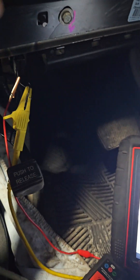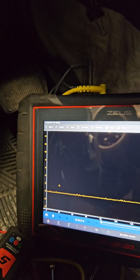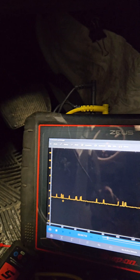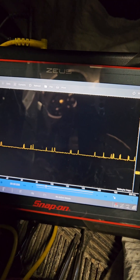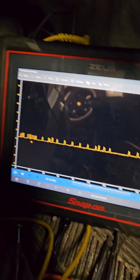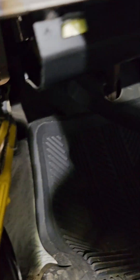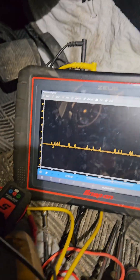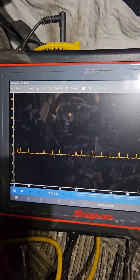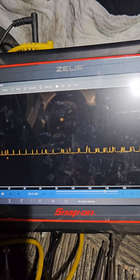Let me go back to my scope and show you what was going on. I hooked up the scope and at first was messing around a bit before bringing out the big artillery. When you have communication issues and all these CAN codes, you need to make sure you have a good signal. I plugged into the OBD2 port on the IHS pin — that's pretty much the interior CAN bus. The other pins are for the powertrain CAN.